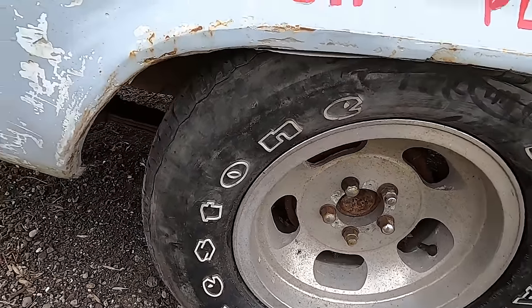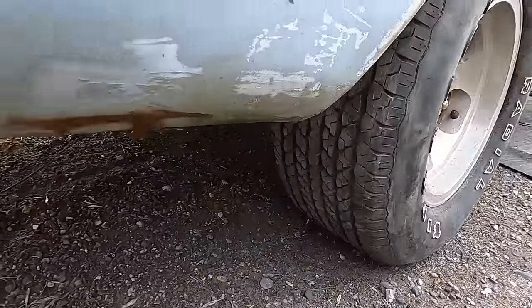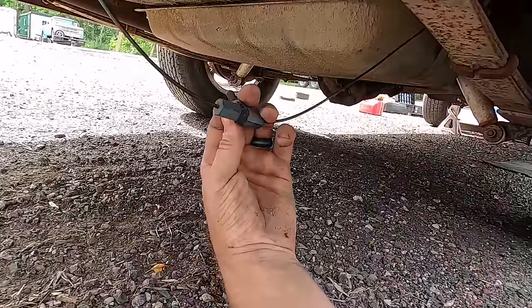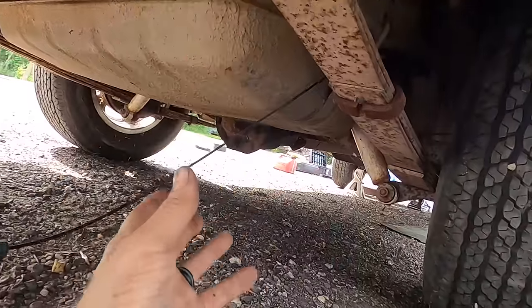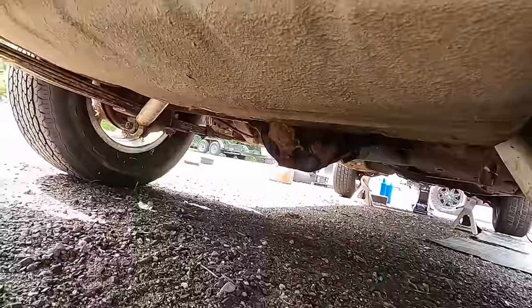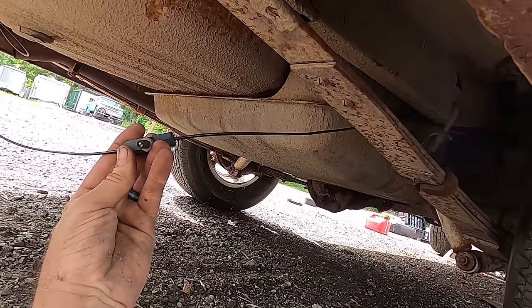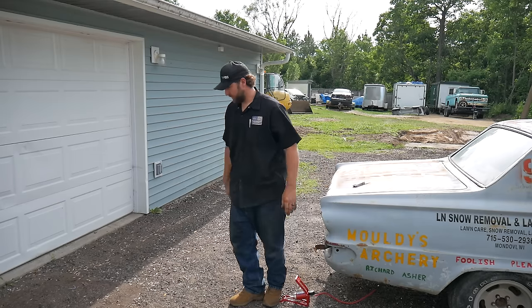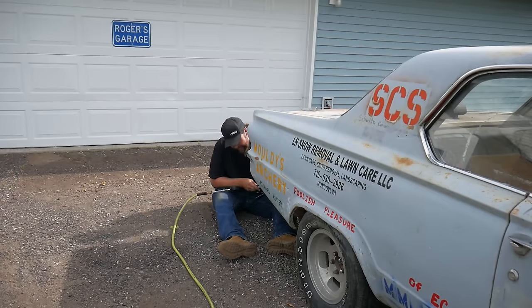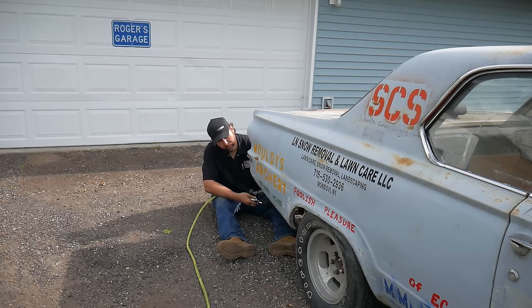The throttle is still sticking — I did add a spring but it's still just not enough to bring her down. It's probably the carb side that's sticky. As soon as I get the thermostat open, I'll sit there and work on it. The engine mounts are a little soggy, and I got a power steering belt that's about ready to delete itself. But it sounds pretty good. Power steering works fine, horn works — I mean it's a go-into-town rig, I'm not gonna lie. Let's see if it'll restart.